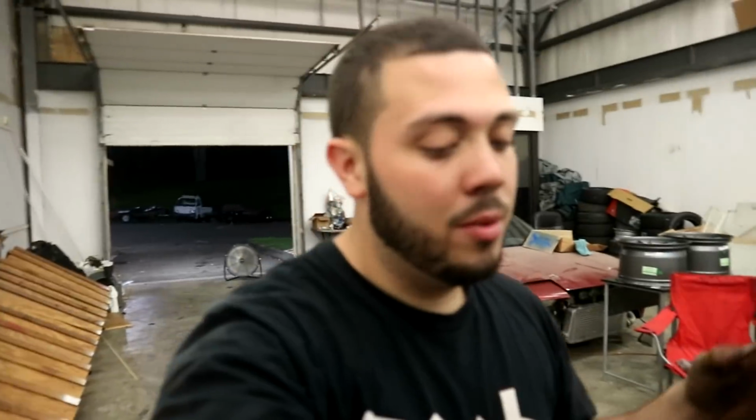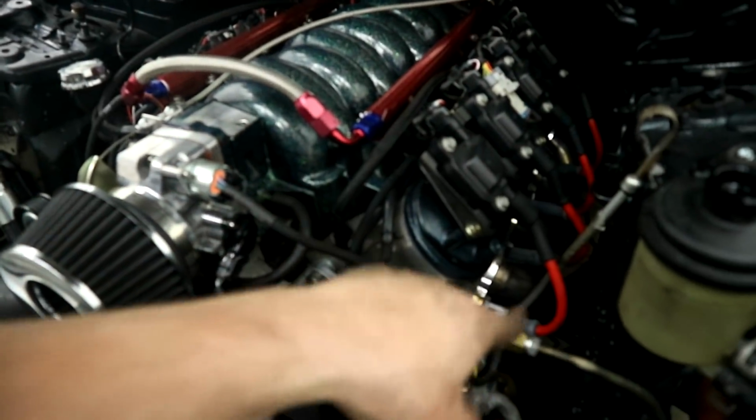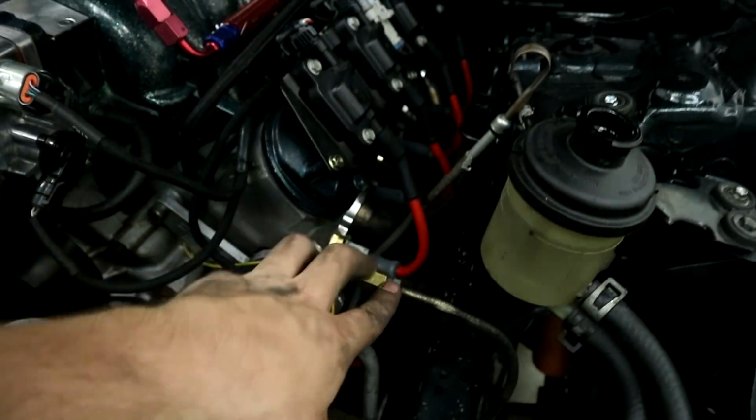All right, well, I just put the first little bit of power steering fluid in there. Obviously, I have to put the belt back on and start the car. So with that being said, I'll know if I have failed, well, partially failed, if this starts pissing. If this doesn't start pissing, I know nothing else is gonna be wrong, and I could say that confidently. So if this union is solid, then this whole operation is a success.